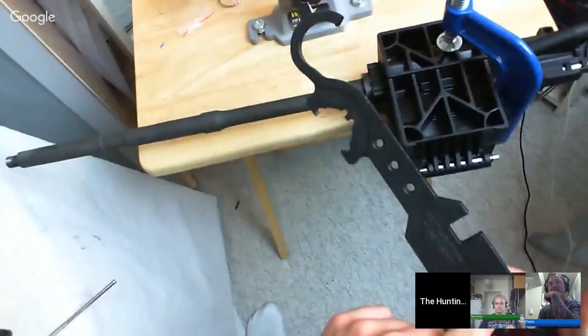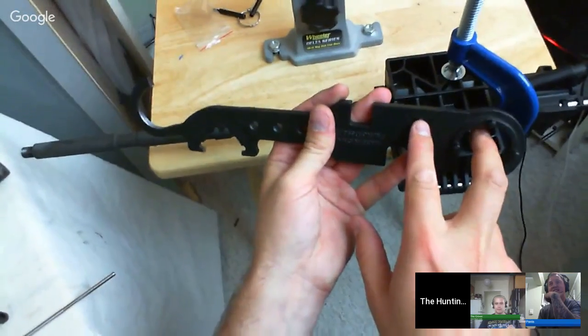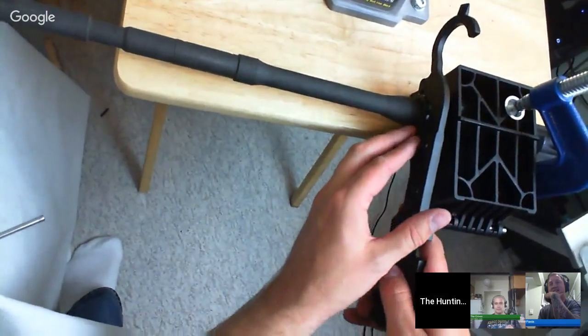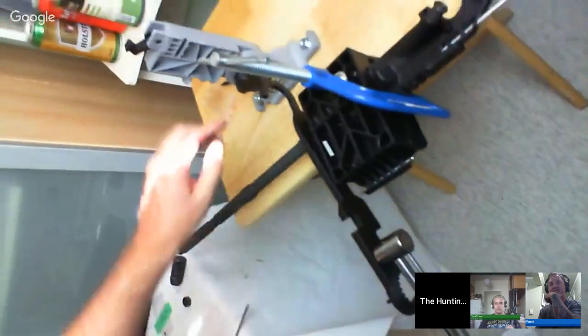Usually you do your torque over here. So I actually had to compare the distance between this hole and this one and this one to figure out how much leverage I'd have to show on the torque wrench to get a correct torque. And the number I'm looking for is 15. Oh man, this is a rickety setup. There